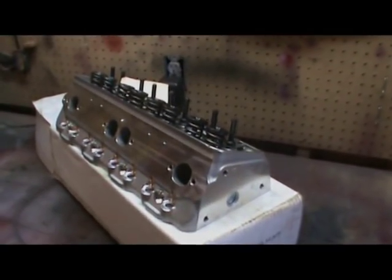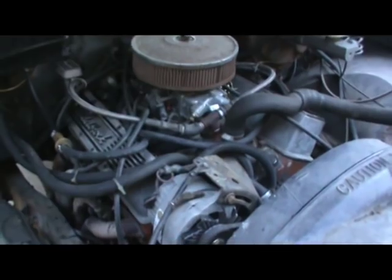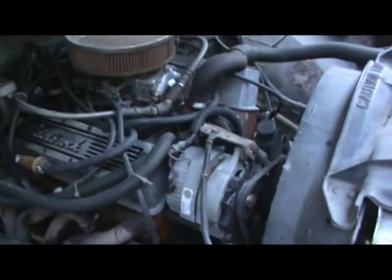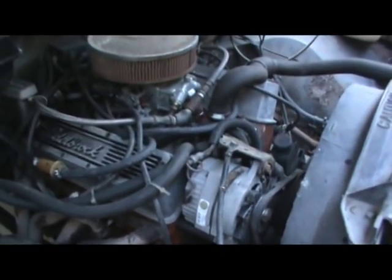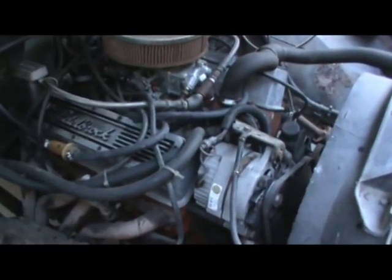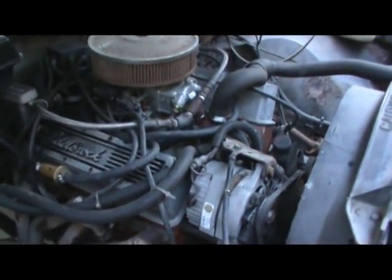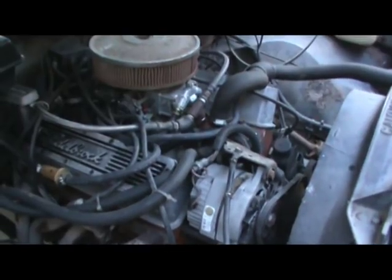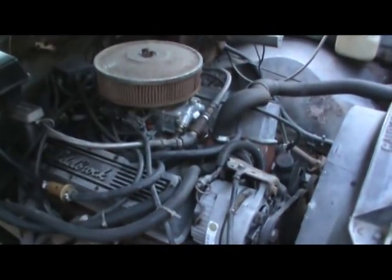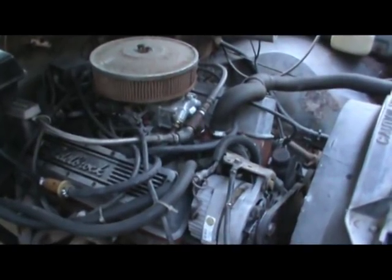There she is, folks. It's sat for about five years, something like that. It used to be a pretty clean engine. Dad, when he was healthy, was always into Chevrolets. He built this motor — I think he had the crank turned 10 and 10. It's got a little bit of a cam in it, aluminum intake, Holley double pumper, roller rockers — all the goodies. I just never was a big fan of the 400s, there are just too many problems with them, but that's what he likes. The motor produced a lot of power when it was running right.